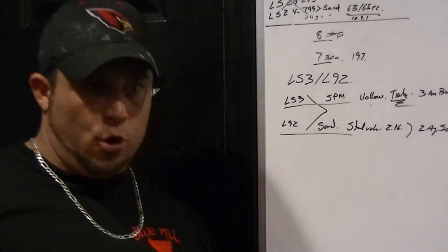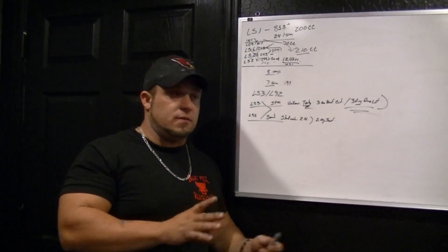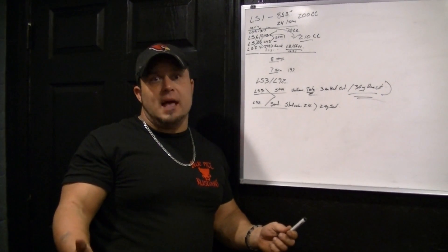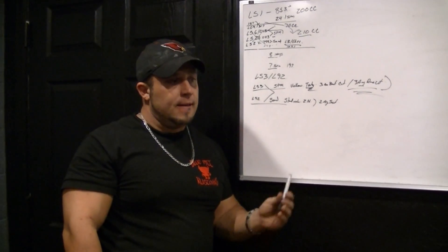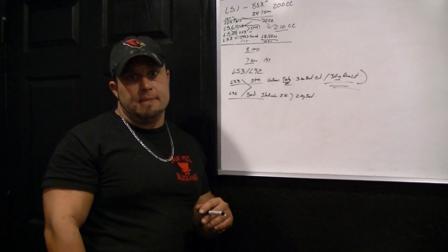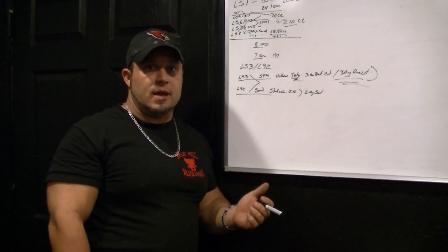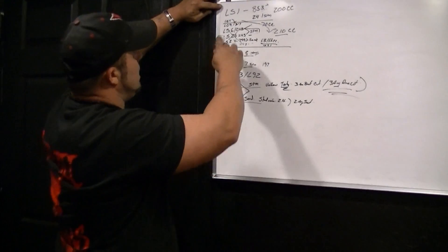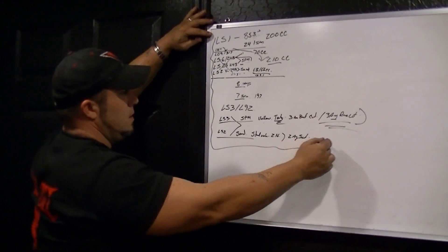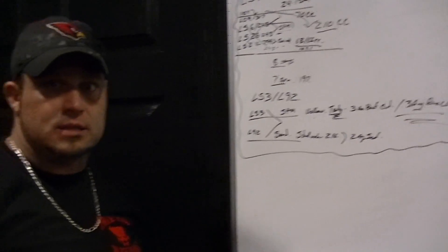A lot of mechanics didn't know they were titanium seats — they don't list that. I've had extensive work with GM Performance. The LS3 cylinder head is no joke. I like it better than the LS7 once ported — the head doesn't stall as bad as LS7. It will work good on a 6.0 liter if you mill it down and fly cut your pistons. Now let's jump back into the LS1, 241s and all that stuff and do a little bit of actual cylinder head work. We're going to take a break right now and jump right back into that.